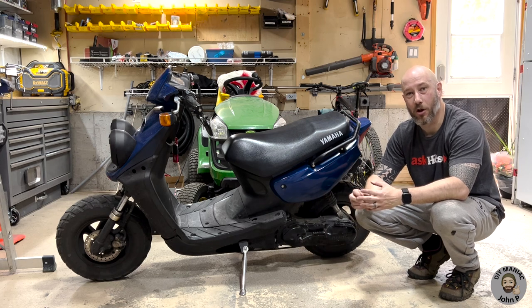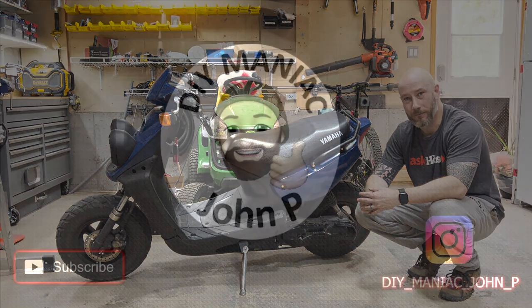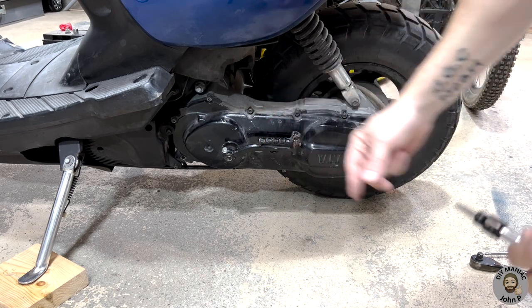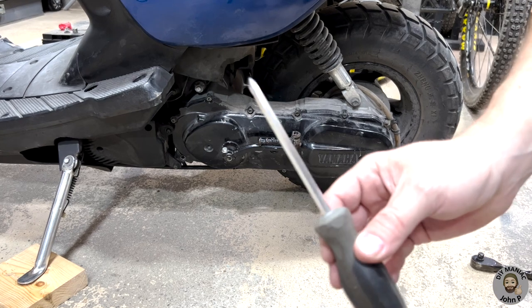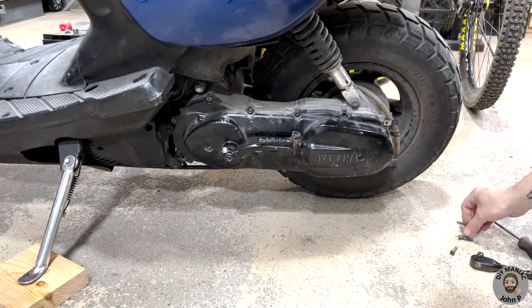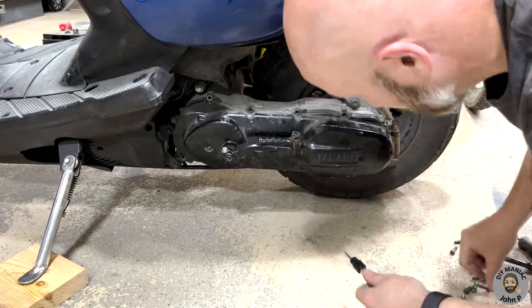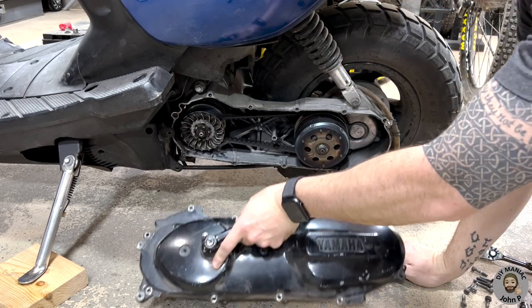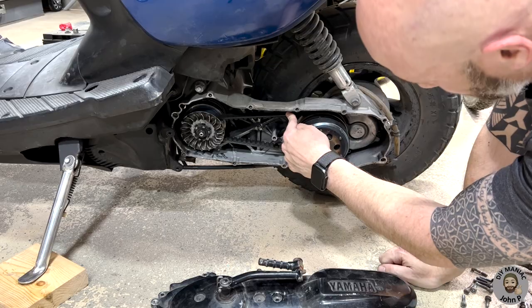To be noted, we will be installing upgraded performance-oriented parts into this Yamaha scooter. Looking at the transmission cover, you're going to have multiple five millimeter hex bolts that will need to be removed, as well as two Phillips screws up front that connect the air filter box to the transmission cover. Using your five millimeter hex, remove all those bolts, taking note that some are longer than others, so remember where they went. Then using your Phillips screwdriver, remove the two Phillips screws. At this point the transmission cover can be pulled away and placed aside. Up front we have the variator and in the back is the clutch, with the drive belt connecting the two in the middle.